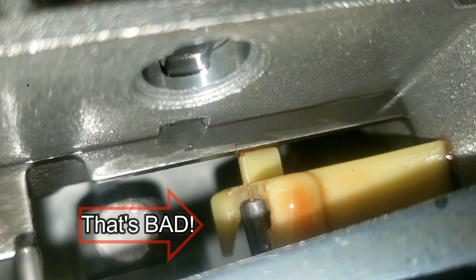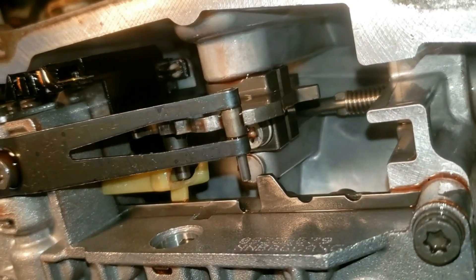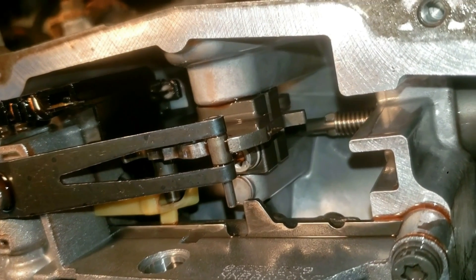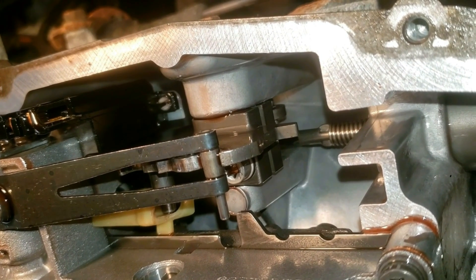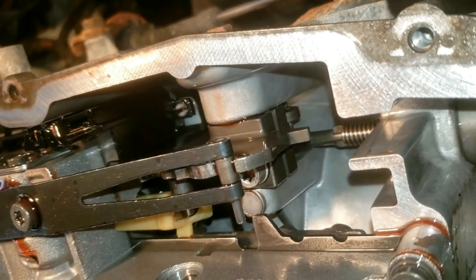When I was on car ramps I put it in reverse and it struggled, and because it was on car ramps I had to get the car down. I just pushed it really hard and it finally worked, but then it never really could accelerate. It was very hard shifting — in the beginning, and later it became easier, but it would never drive. There is a flaw with servicing these transmissions for Chrysler, Dodge, and Mercedes, and why you need to be careful.